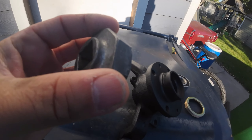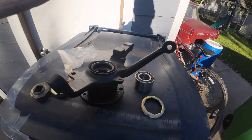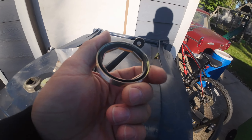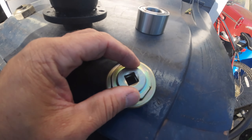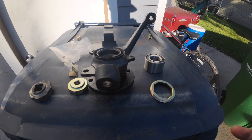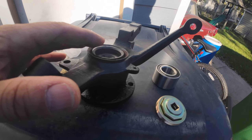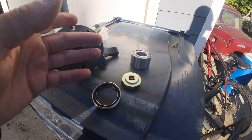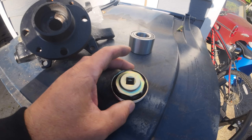I did find one but it was the wrong size — it's for different size rings. I am replacing wheel bearings even though these are still good; figured I'd throw in new bearings. This is the type of bearings they use with screw rings, not a snap ring like you usually see. I don't like them, but with this tool you can actually torque them down to spec. I had one tool made but it wasn't hardened steel and it kept slipping — it wasn't made like this. This is a heavy duty original tool for these. After you take this piece out, you'll see this ring on top, and you use this tool to remove it. You can remove it with screwdrivers, but to torque it down you actually have to have a tool, otherwise these wheel bearings will go out quick.